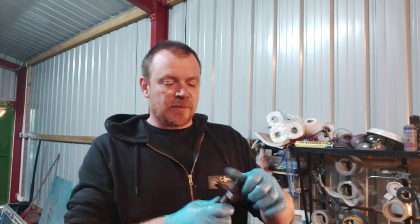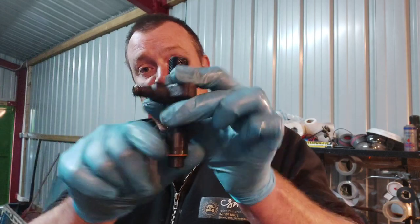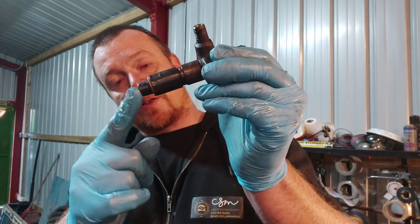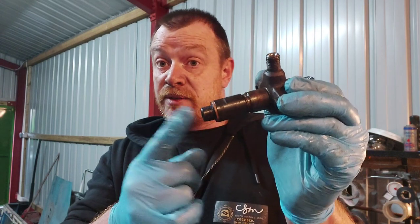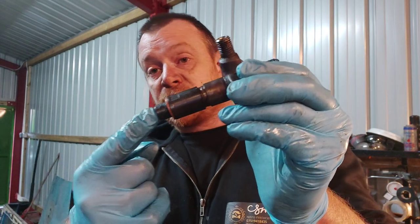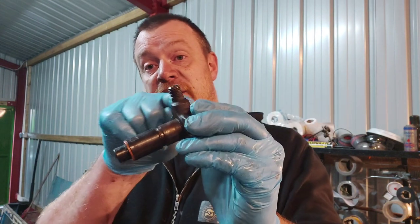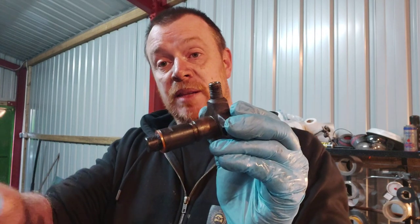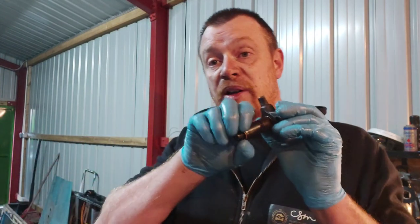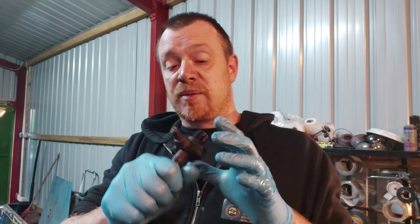Providing the timing and everything's where it should be, it'll be at the correct time. It comes in from the pump down into the side here. Inside, you'll touch the end of it — there should be a point on the end. If there isn't a point, then you need a new nozzle. That nozzle is spring loaded. The pressure of the fuel coming in pushes that nozzle up, there's a spring inside there, and then it allows fuel to squirt out the bottom under high pressure. It should atomise and spray out in all directions equally — there shouldn't be any big blobs. It should be perfectly uniform.